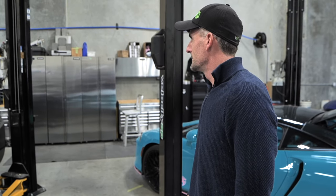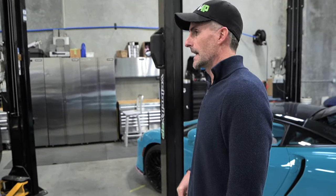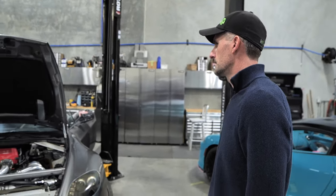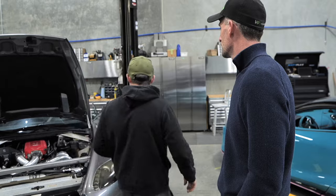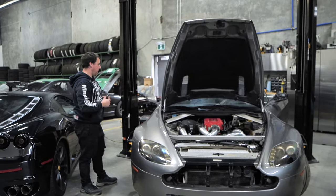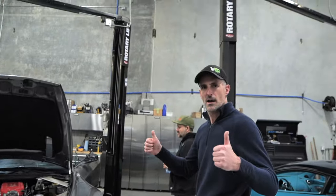So my two-amp might go to a four-amp. How long did it run for? It didn't run. It ran if he gave it a bit of boost, and it sounded good and chucked some stuff out. It's basically saying it's getting no power to the cam. And the fuse either blew or was pulled. They're running the pump off of that same fuse — the coolant for the intercoolers. The coolant pump is probably like a 15–20 amp pump. That's why, as soon as I plug it in, it starts going. Give her a shot, it's still going down.